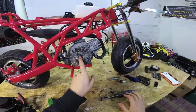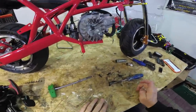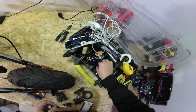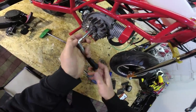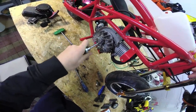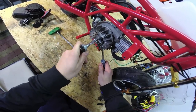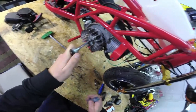Use a good quality tool for that bolt — I think it's number 10, though in some bikes it can be number 14 as well. As you can see, when I turn it, it turns the whole engine and it's impossible to remove that bolt that way.